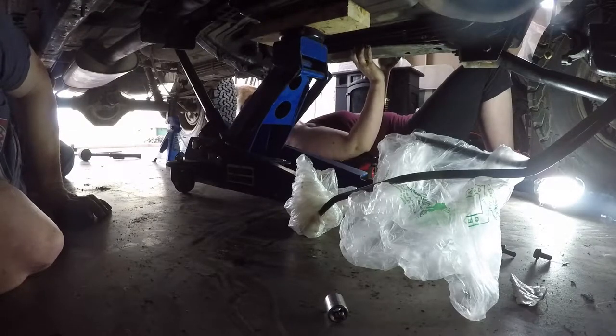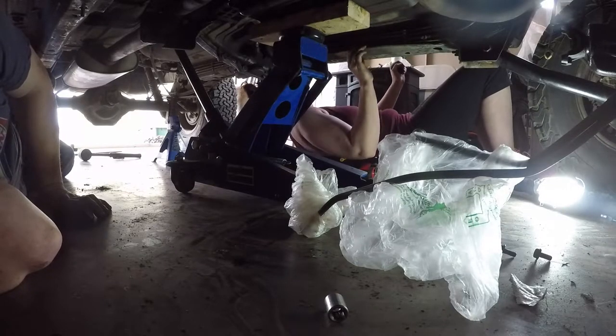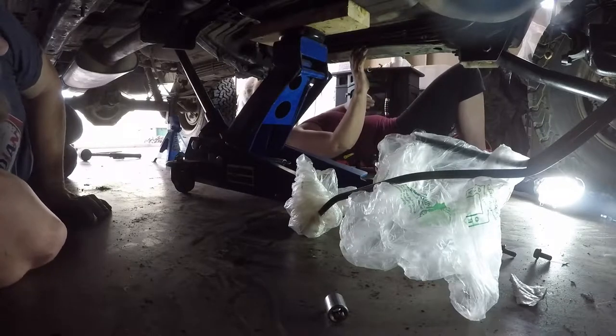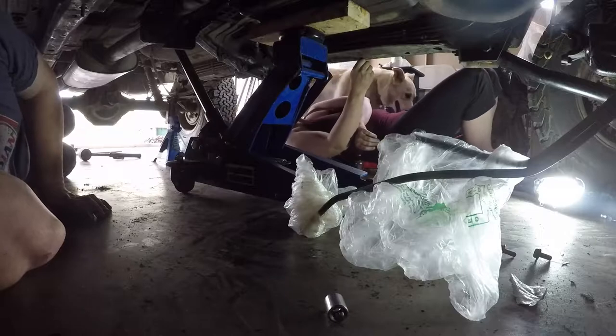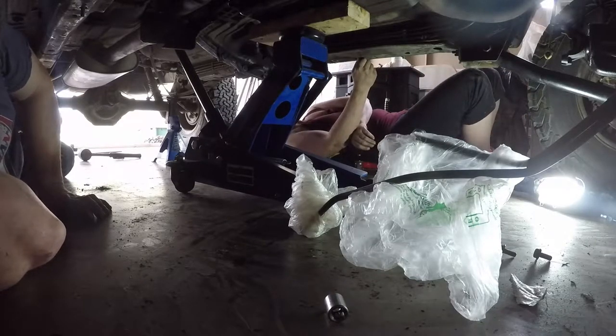Advise that for future reference, because if you've got a rusty exhaust, it's most likely not gonna hold. Yeah, you can remove the exhaust if you want to, but I would recommend not doing it. And I would also recommend putting straps in if you're just going to leave the transmission hanging. Speaking of straps, shouldn't we do that to brace both ends? No, because I want to take the transmission out. You want to drop it completely?